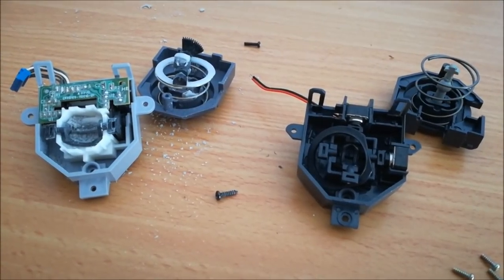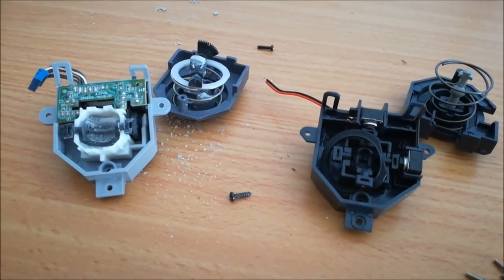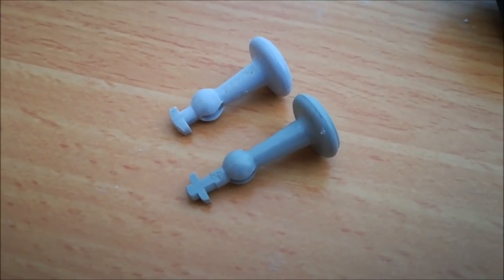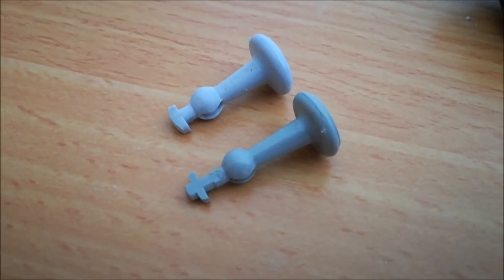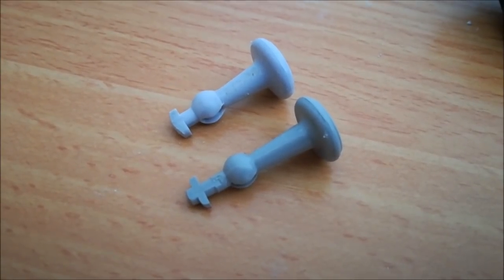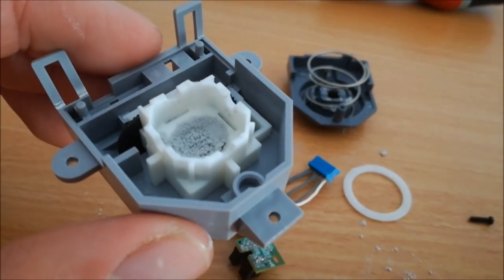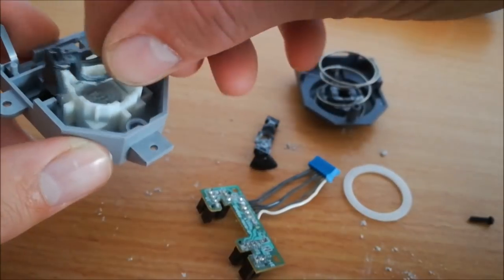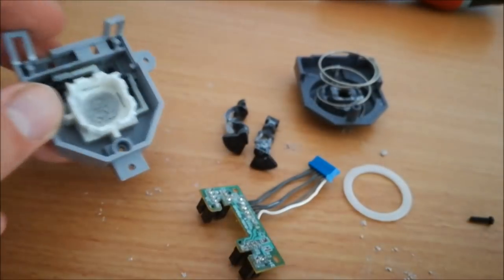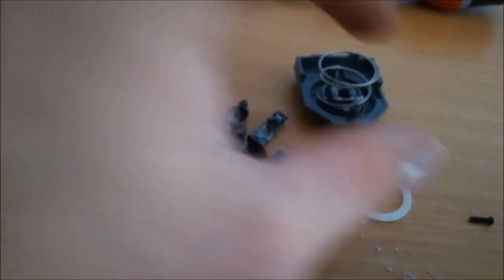The main question: can we replace parts? Can we use the China clone parts with the original to make one good stick? No, we cannot. Comparing the little joysticks, they are totally different. The original is on the left and the imitation is on the right — the fake one is a little bit longer, so you cannot use it. The connection and how the signal goes out is totally different, and the Nintendo version has its own original little PCB board inside. So nope, you cannot do anything with it.